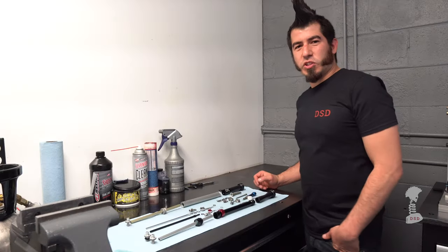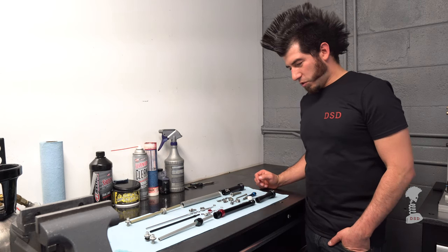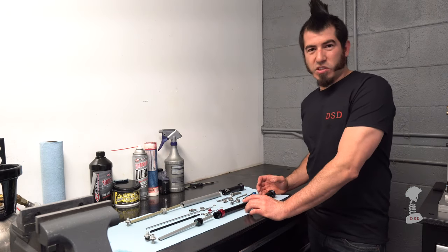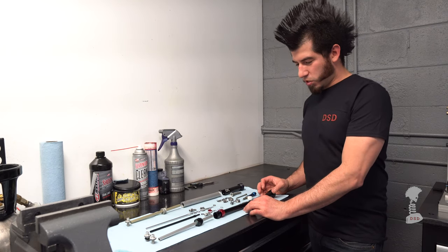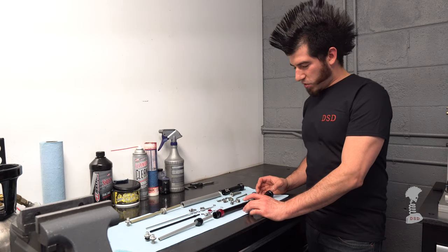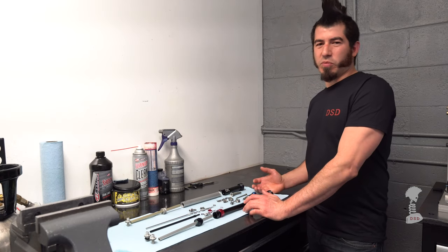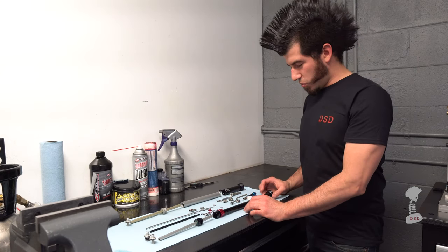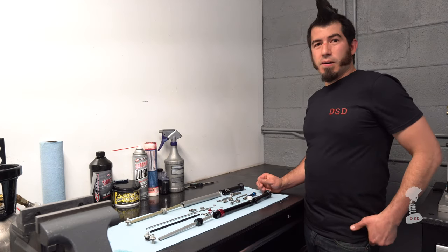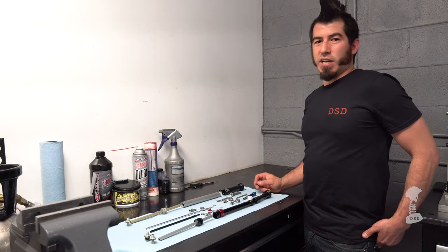You have to send Charger 2 in because the whole upper half of Charger 2 is not supported by RockShox — there are no instructions on how to get in there, and if you mess up a part you have to purchase a whole new damper. There are no replacement parts for the upper half of Charger 2, so that's the main reason it has to come in.